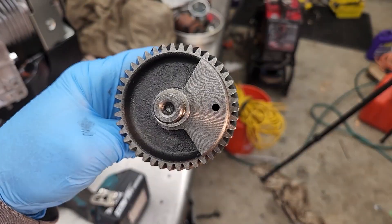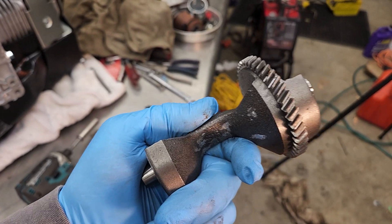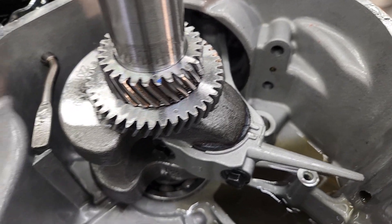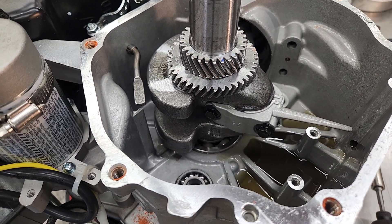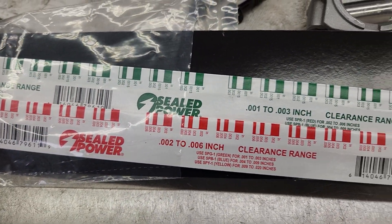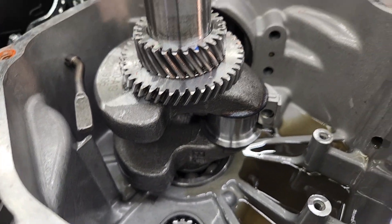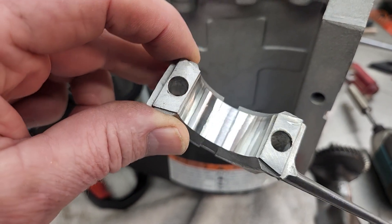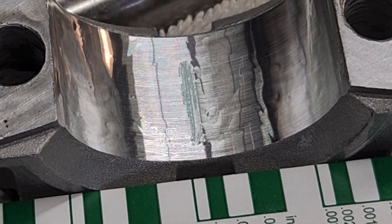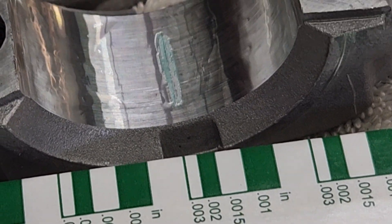Here's a picture of the balance shaft from the old engine - you can see there's aluminum all over it. It's basically a counterweight for the crankshaft. Here's a picture with all the internals taken out except for the crankshaft and connecting rod - you can see it's a nice little setup with roller bearings for the balance shaft and crank. I've got a plastigauge and I wanted to see what the clearance between the connecting rod and the journal was on the brand new engine, just to make sure my old crankshaft is within spec. Here's a shot of the crushed plastigauge on the journal - it's about two-thousandths. Briggs doesn't have reference manuals that tell you the clearances, so I used the crate engine as a reference.